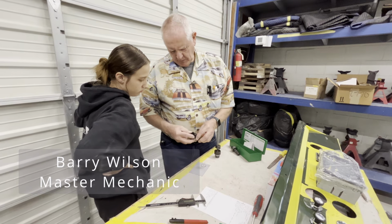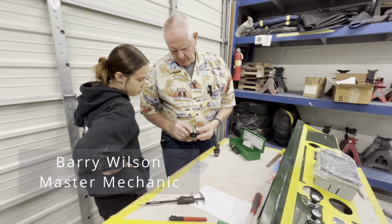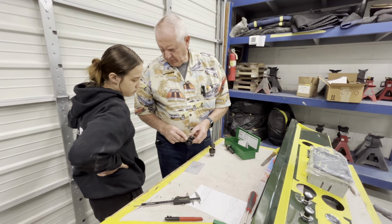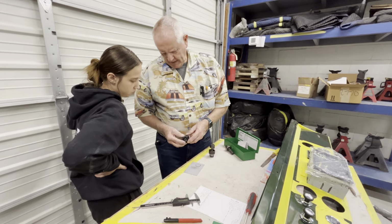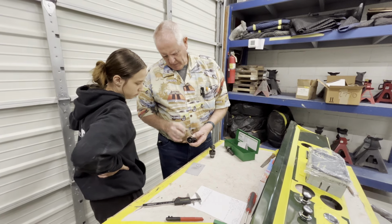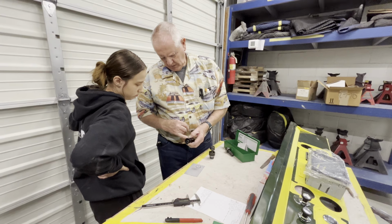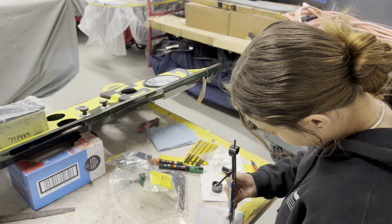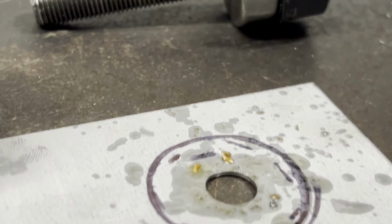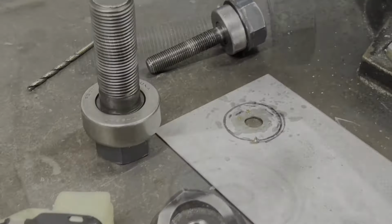Right here to keep it from moving. And then we've got to go in there and cut it, take a saw and cut the slots in there. And then we've got to make room for the snap. Okay. And the snap has to be so that it'll go in there and snap back up. So we want that hole to be, you know, see how far it sticks out. That's where the hole has to be. If you make it too big and this slides in there, then the snap won't work. Two things happen here.